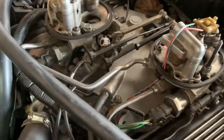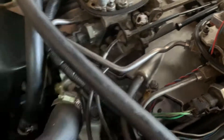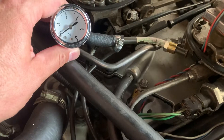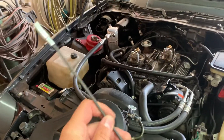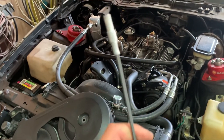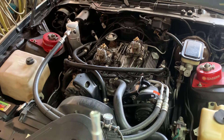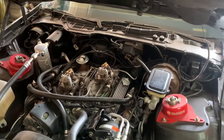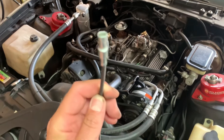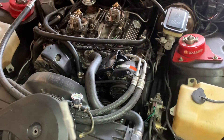When you're doing your fuel pressure, you remove this line from here and replace it with this line, so when you're running you can take a reading. I also had to make a tool — this is a tool for setting idle mixture screws on a Rochester Quadrajet. Any E4ME '81 to '90 Rochester Quadrajet feedback uses what's called a double-D bit to adjust the idle mixture screws on the base plate. So what I did was I took that double-D tool and I just lightly compressed it and flattened it out with a small hammer.